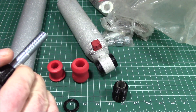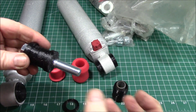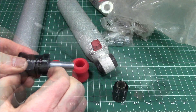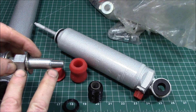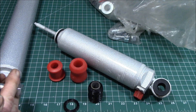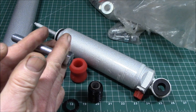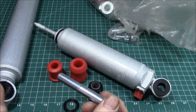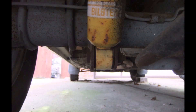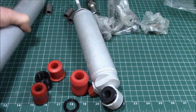This is the L1 straight bushing I made with a 12 millimeter diameter. You would want to use a sleeve if your bolt doesn't have a shoulder, because there's nothing preventing you from over-compressing the bushing. Sometimes you have two ears that stick out and the bolt goes through the middle with the shock trapped in between — in that case, if those two ears are thinner metal, you might need a sleeve in the middle to keep from bending those ears.